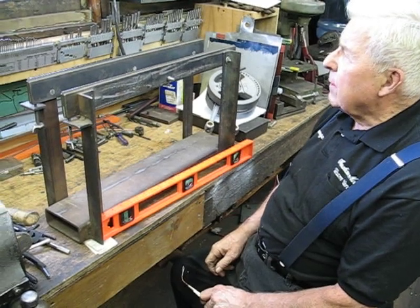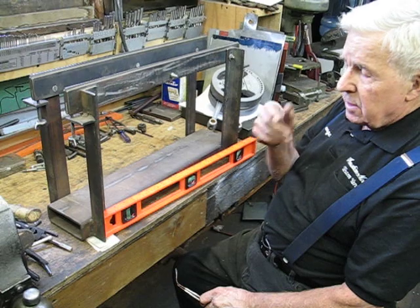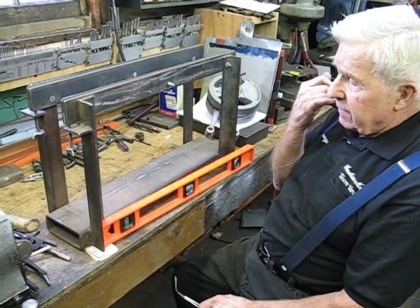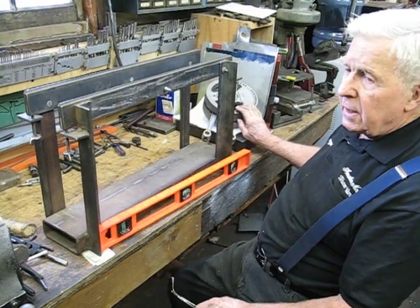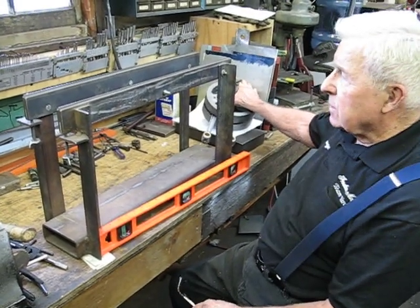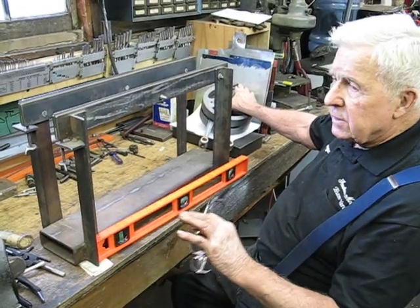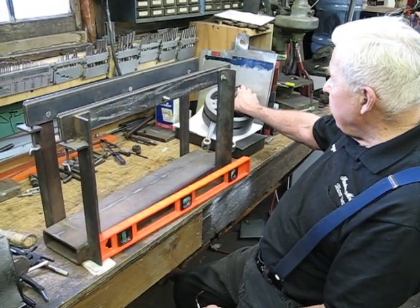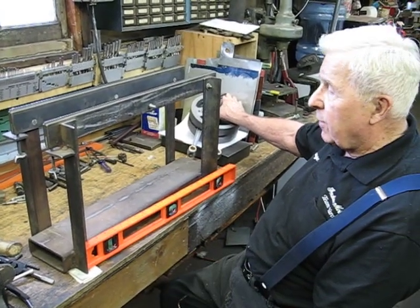And now we're going to balance. We do that with one piston, one wrist pin, one set of clips. The difference here is we've got a 40 and a 50 piston. To do that we take and we weigh them, get the difference in weight, and then we add half of that difference to the smaller piston — in this case the 040.